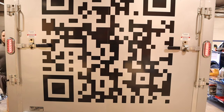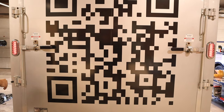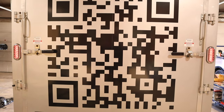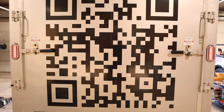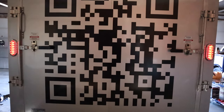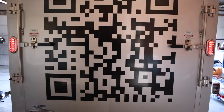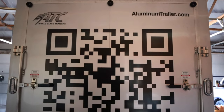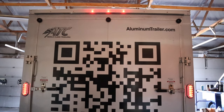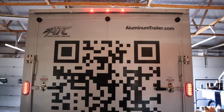Jordan's going to keep the camera on the back of the trailer so you can see the lights — these are the parking lamps there. I feel like they're dim, but if you wiggle around the connector, it really gets dim. Are they flickering back there? I'm not even disconnecting it or pulling it apart — this is literally just me wiggling the cord and the lights flicker because the contacts are on springs. If you get some gunk, like I'm literally just barely tweaking the connector.